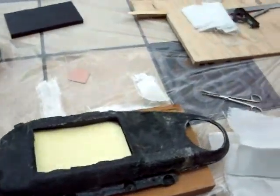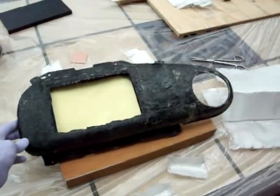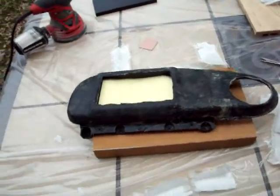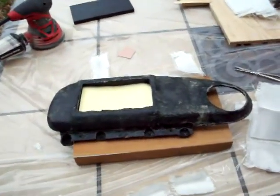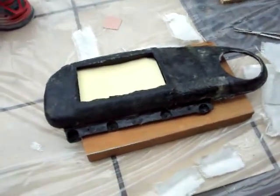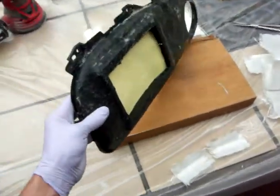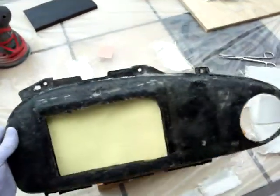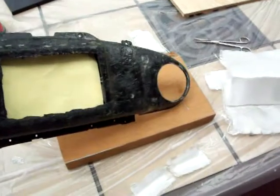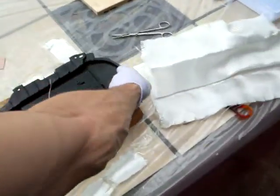First, I already had my cutout, as you may or may not have seen, and I put the frame where I wanted it to be. Then we stretched the material over it. Then we put the first layer of resin on and let it harden. Now I've got one layer of glass on it, not sanded — very rough looking. Gotta remember, it's my first time. But I'll clean it up and get another layer on there and pretty it up with some kitty hair and some good old Bondo.